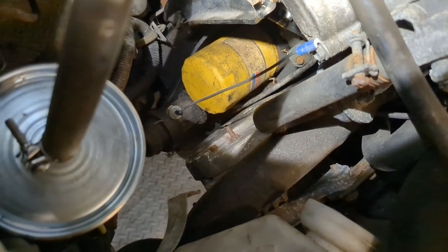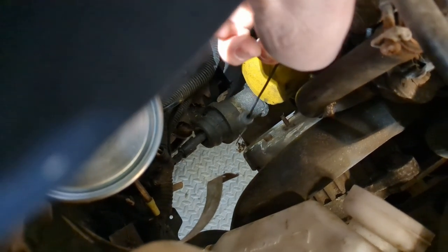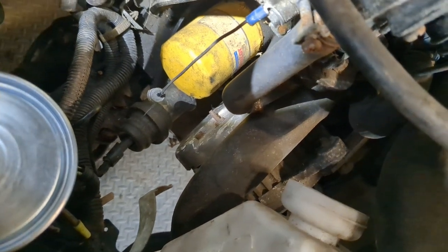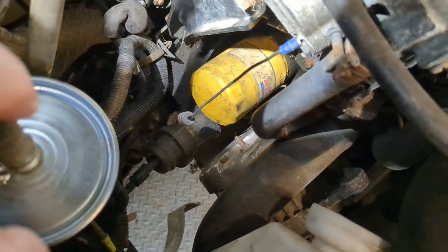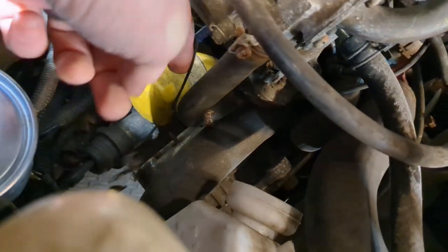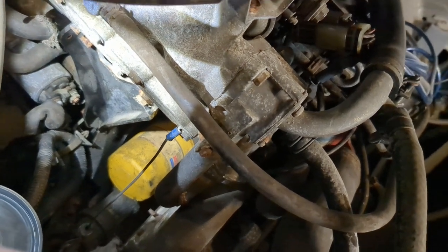I am almost certain. Whether or not they had it hooked up that way, or whether that wire has just been chilling and dangling, which is also very possible. I went ahead and disconnected everything on the alternator so it couldn't happen again. But I'm almost certain, and it matches the symptoms so well. Somebody fried the ignition system on this car by doing something here with the alternator wiring. Because if you send 12 volts to the intake manifold metal, guess what's grounded to that intake manifold?